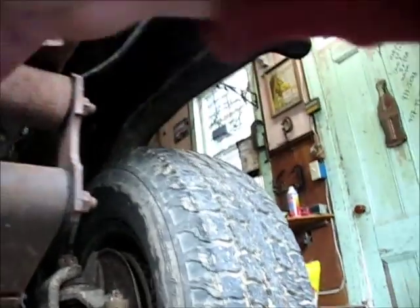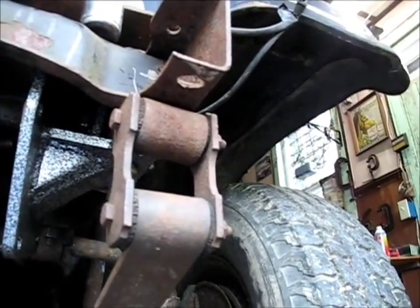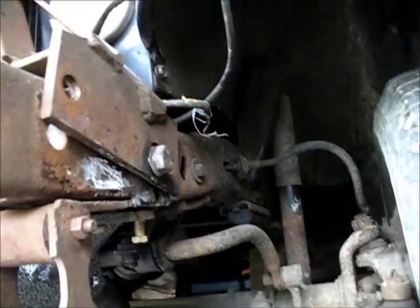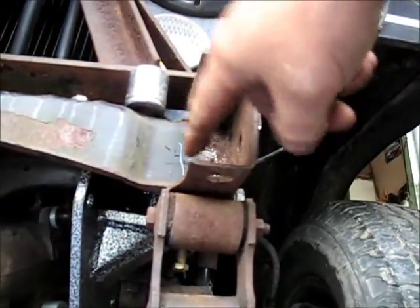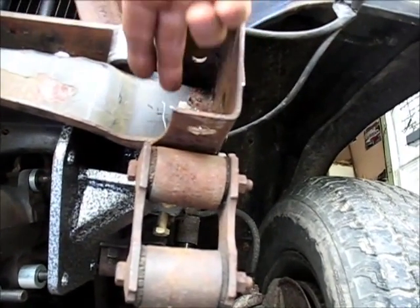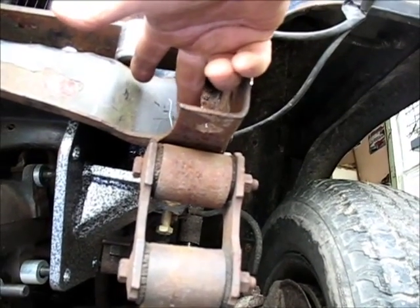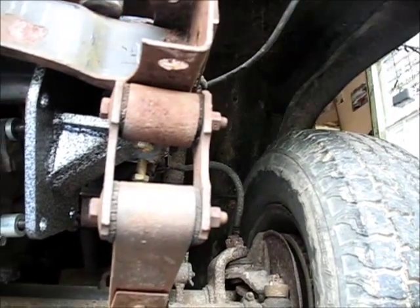I thought about taking the box down and going in and cutting this box part of the frame in here, but having the box in there is kind of what's holding everything aligned and in place. I'm thinking what I might do instead is just come right in the front of this cross member, cut me a little square hole right here that I can reach a socket through in order to attach a nut and a lock washer inside there.